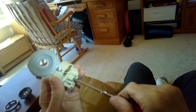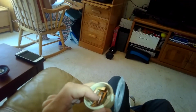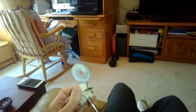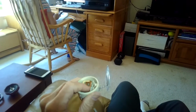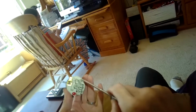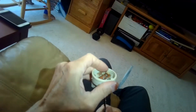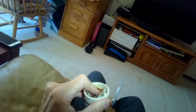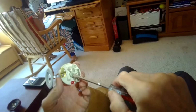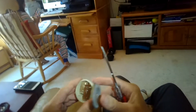So the further I go with the middle screw, the further I go out, that to me feels like there's less and less pressure needed to activate that. So I think if you had a pump that just wasn't doing it anymore, you could turn the middle one counterclockwise, and you could turn the corner one also counterclockwise, and then there's going to need to be less pressure here to close the gap. So it looks like counterclockwise, counterclockwise.